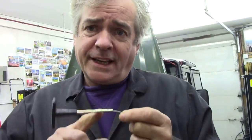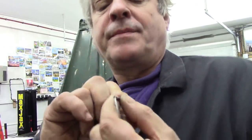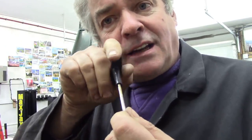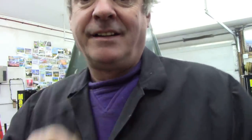Now could we solder that inside there? It would be a good idea but you've got to be careful with your soldering because they've got a groove here - this is to stop the handle twisting. If you get this built up with solder there's an awful lot of filing to do in here. Bit of a pain really. The rest of it's great - there's nothing wrong with it, it's just that bit.